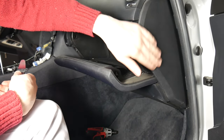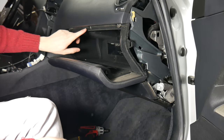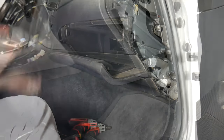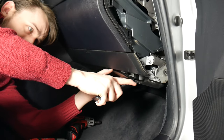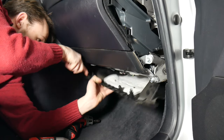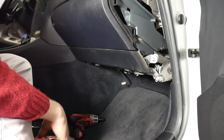To start off, we'll be removing this side piece of trim here — you can use your pry tool for that. Once that's removed, we can go ahead and start taking the screws out of the top. Next up we'll be removing the bottom piece down here that covers all the AC components. We're just going to take a pry tool — there are a few clips all along this side — and once those are out, you can pull it towards you. There will be one plug here.